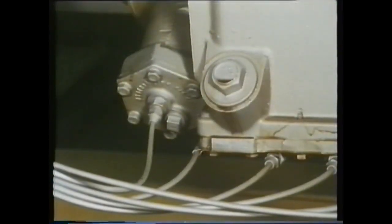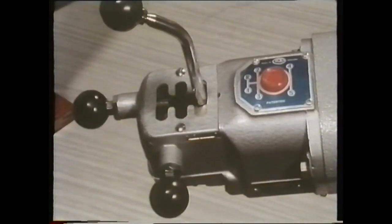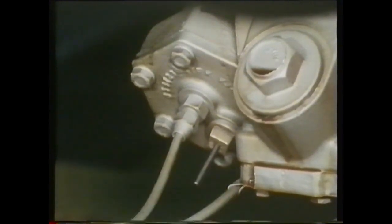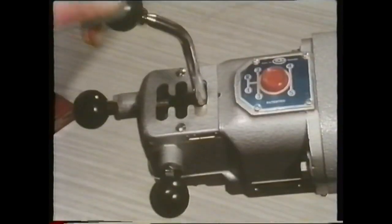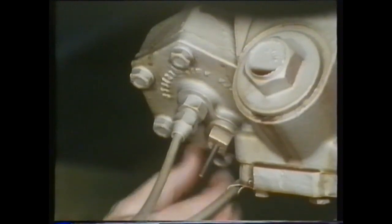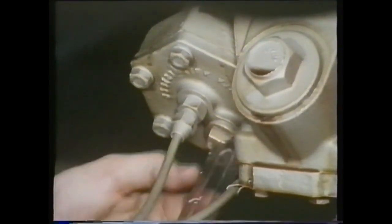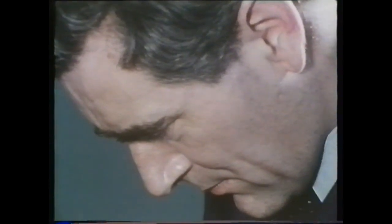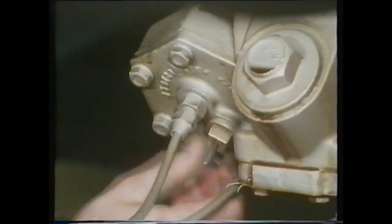If the one gear slip condition hadn't been on any of the indirect gears but on top gear, a different adjusting procedure would have to be applied. First, remove the drain plug and substitute this depth gauge adapter. With top gear disengaged, screw down the threaded portion of the centre of the adapter until it just touches the base of the piston and take note of the measurement. Now place the gear control lever in the top gear position. Return to the gearbox area and screw the centre of the adapter down once more until it comes to rest on top of the piston and take a second reading. The difference between the two readings indicates the true piston travel and this must always be maintained or adjusted by the use of shims on the piston push rod, or a slip condition on top gear will result.